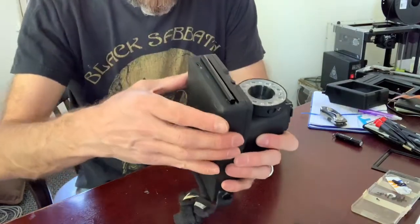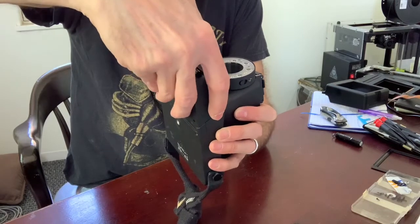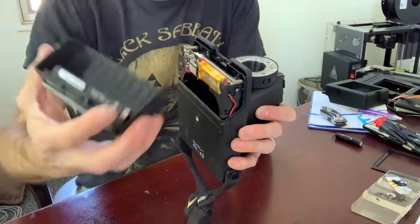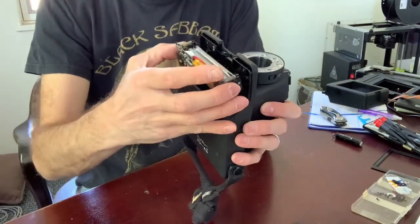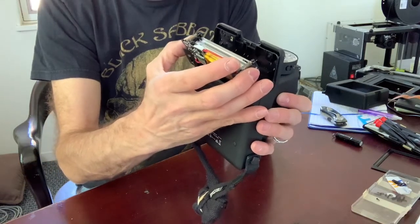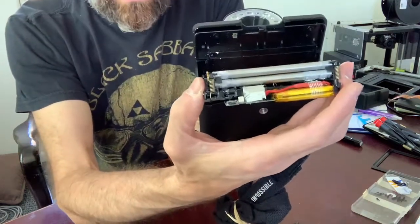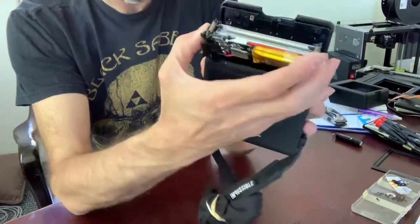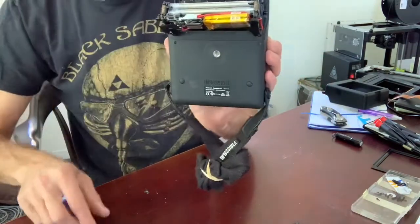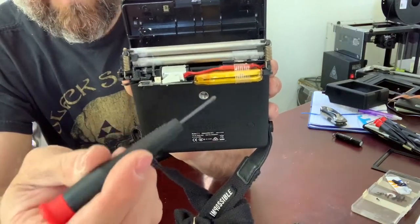Once you do that, you will unlock the front of the camera. Slide and take the top cover off — you see that the actual eject mechanism and everything is just hinged there. We're not going to take it out for this battery replacement. This camera also has dirty rollers and we're going to clean that in the process.